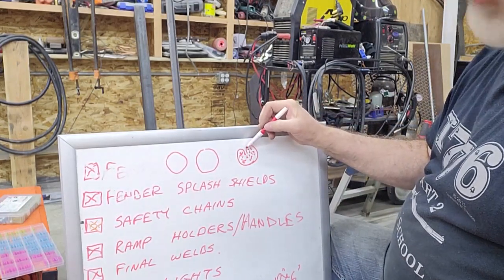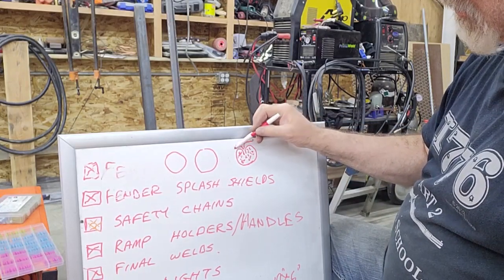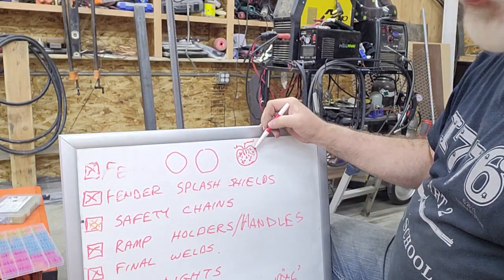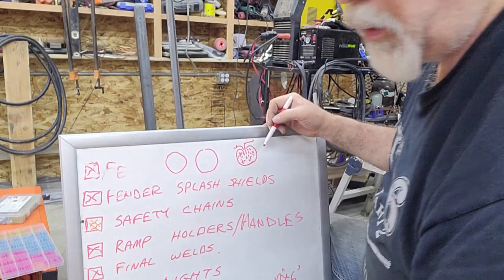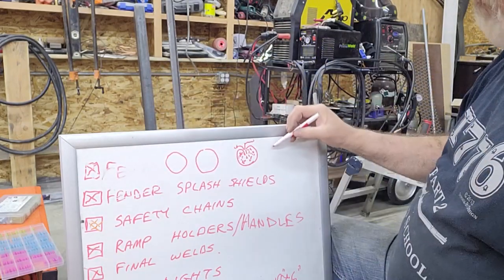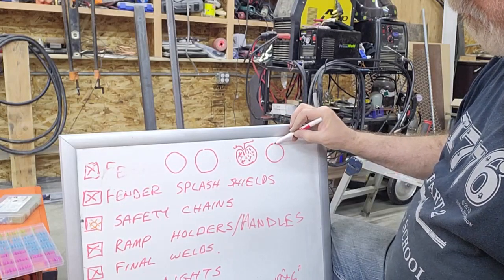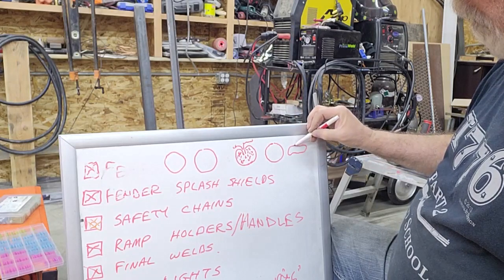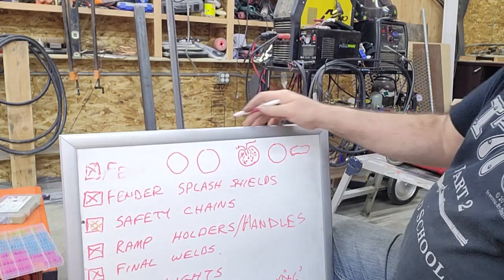You shouldn't use these on insulated terminals, because that little nubbin on the crimper that comes in here like that will puncture through the insulation, so you've kind of defeated the purpose. So on insulated terminals, heat shrink or not, you use a crimper that's somewhat like this, and basically it just takes that round butt connector with that joint, and when you're done with it, you end up with kind of a smashed affair. Still works just fine, but you don't get that roll effect.